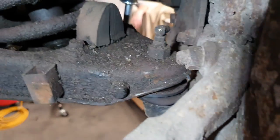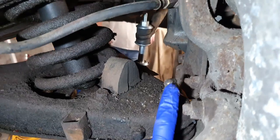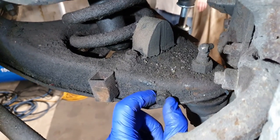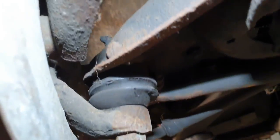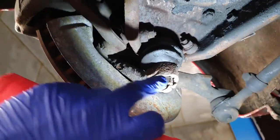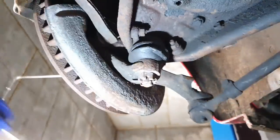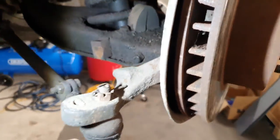Here we've got the bottom ball joint and the seal. It's held in by the nut you can see at the top there - this is the greasing point as well. This one is held by two bolts sitting on the side. Some of them actually got rivets on the sides - the original ones. I think this one might have been replaced already. There's a big nut at the bottom with a split pin sitting there holding it. I need to clean all of that off. There is pressure from the spring when you're doing them, so I have to be careful with that part.